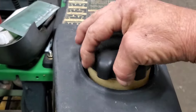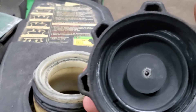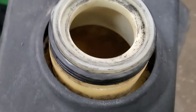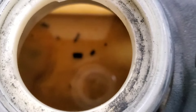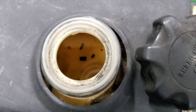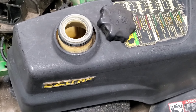Pull your gas cap off. See all that black around the threads? That gasket is basically gone — it's all down in the fuel tank in pieces. What you want to do is suck all that old gas out, clean all this mess out. I use my air-operated oil extractor to vacuum the bottom of that fuel tank. Sometimes you can just take the whole fuel tank off, flip it over, rinse it out really good, and let it dry out in the sun.